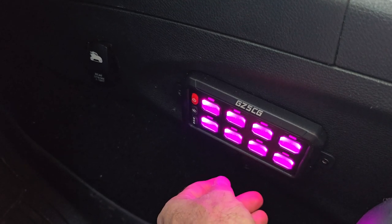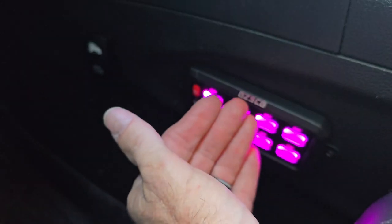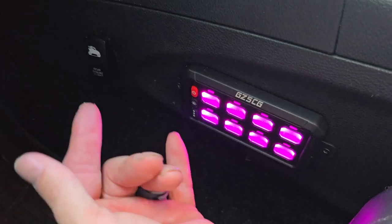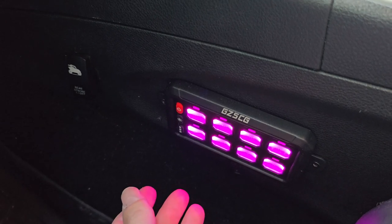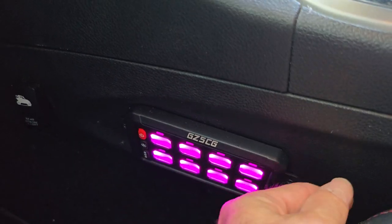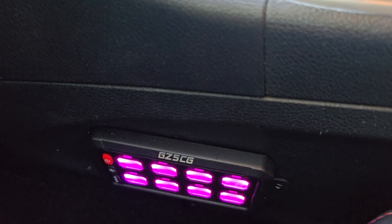I definitely didn't want to pull both of them off the same fuse. Since the fuse I pulled off to make our control panel switched is all doing is power and relay, that's very little juice that it's pulling, so you don't have to worry about blowing fuses up there unless something majorly goes wrong. That cleaned up the setup a lot — I did have a bunch of toggle switches up here with a whole bunch of wires running from here underneath the seat. But I still used the battery post under the seat to hook everything up instead of going through the firewall.